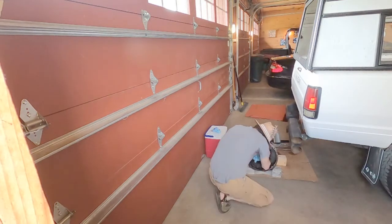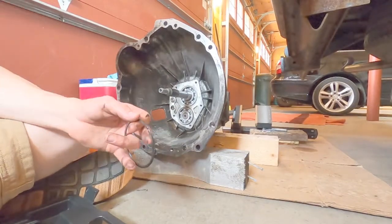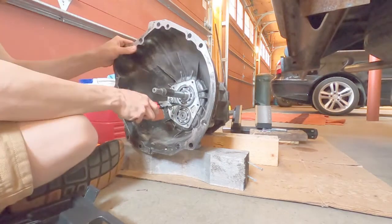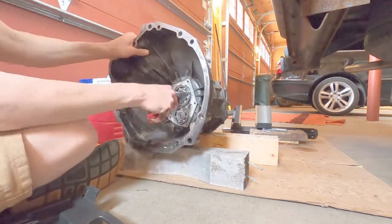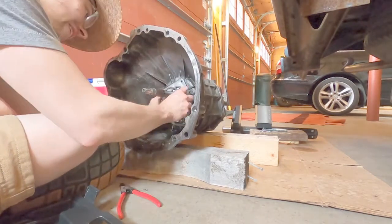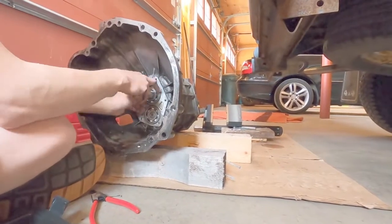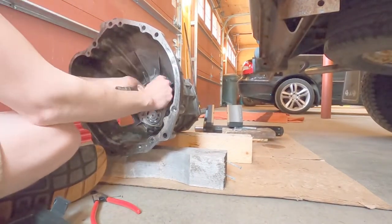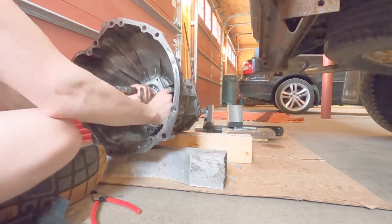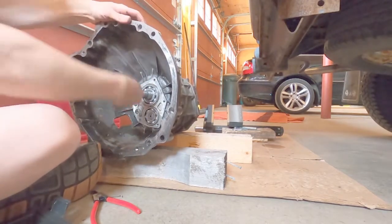and the lighting in the garage was nice, and I was in a good mood to just start a time lapse and show it. So, little narration. I've dropped in the whole gear assembly, the shaft assembly on the center plate. Just drop that in up on blocks because that input shaft sticks out a little more. But if you're at this step of building your own or rebuilding your own FS5W71B or C or whatever, you know that.